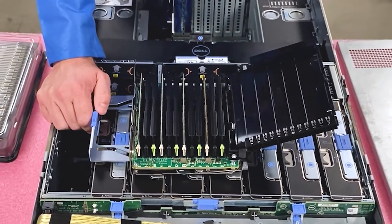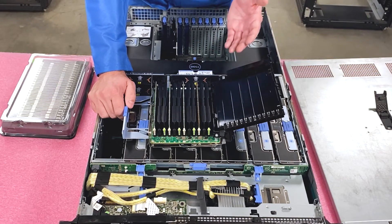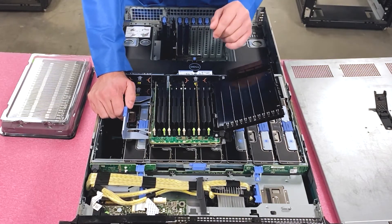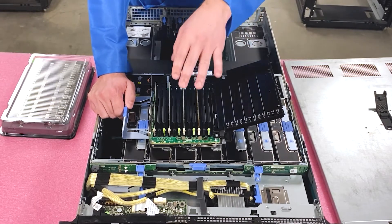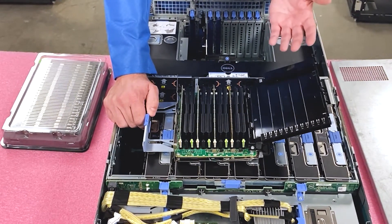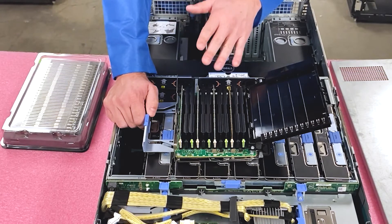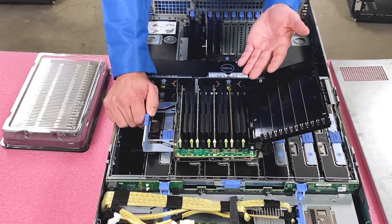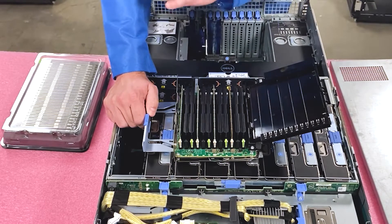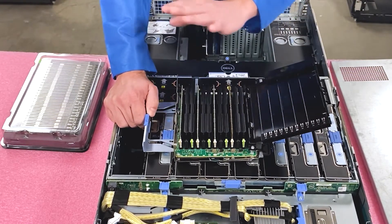This is actually really important to note. We mentioned earlier that if you're using ECC registered, you can max out at two terabytes via 64 modules of 32 gigabytes. There are no 64 gigabyte ECC registered DIMMs — in DDR3 there's only 64 gigabyte LRDIMM. There are three DIMMs per channel, and the rank rule simply states that per memory channel — so for these three slots — you can only have eight ranks. So if you're using 32 gigabyte DDR3 memory, all 32GB DDR3 ECC registered are quad-ranked. If you're using 16 gigabyte or 8 gigabyte, those are dual rank — you could fill the whole thing up.